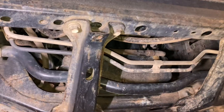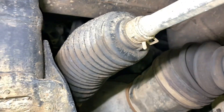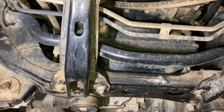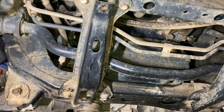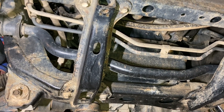That's probably why we see this quite often with KO2s - it's why some people don't like them. That's about all we see underneath here. The Hilux is a pretty awesome vehicle; there's not a lot to see underneath compared to a Prado. This one has a bit of sweat on the boot at 300k but the Hiluxes generally don't have the play in front wheel bearings that Prados often do, and they don't have the rear upper trailing arms to wear out. The Hilux is actually a bit more solid and less maintenance required. Hit the like button if you liked it and subscribe - catch you on the next one.